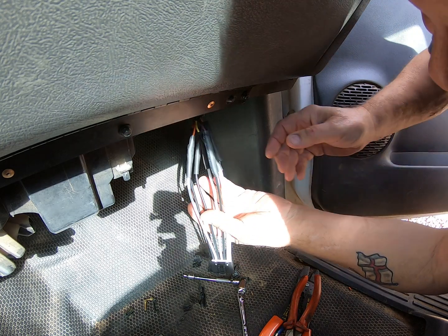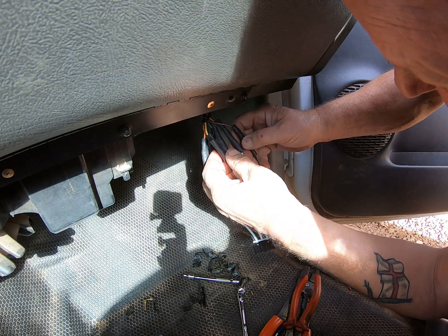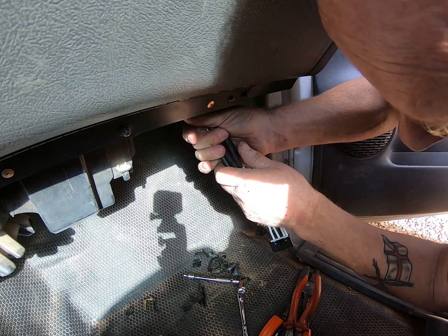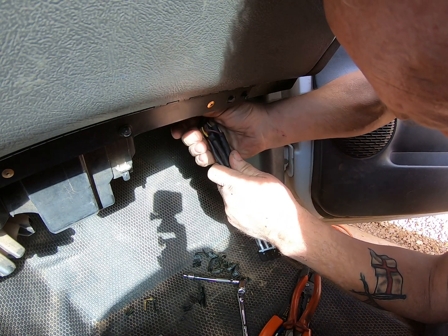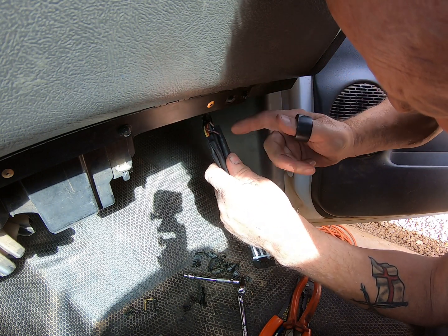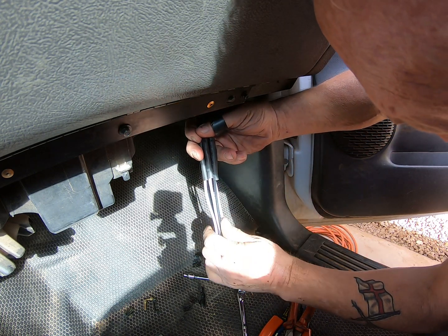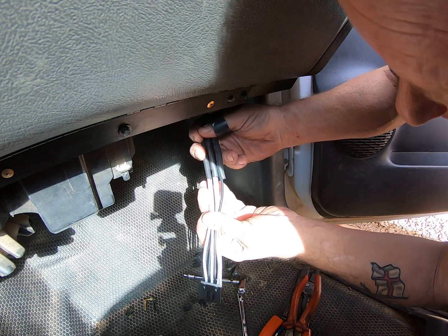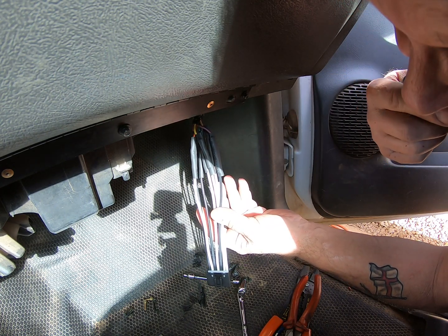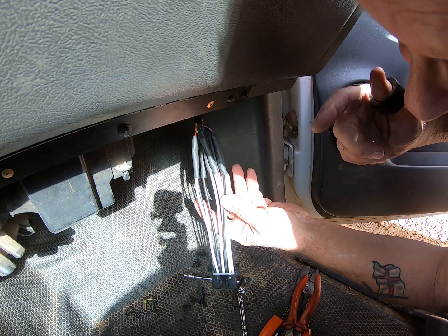Okay, as you can see here, I've now completed all the wires. They're all connected. I tugged on every one of them in the hope that I'd made a good connection. Next, what I'm going to do, and I really do detest doing this, but I'm going to wrap tape around it just to keep everything neat and tidy with some black tape. I used to have some tape that would bond to itself, but I seem to have mislaid that, so I'm just going to have to use normal insulating tape, which is not perfect, but there you go. All right, so let me get that done, then I'll show you putting the resistor back in, putting the fan back in, and I'll show you as well how the fan comes out, because it is really simple.